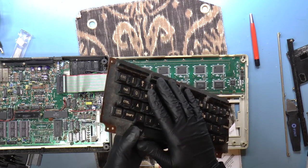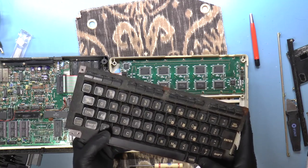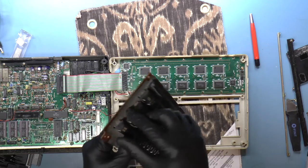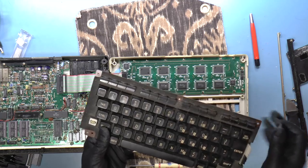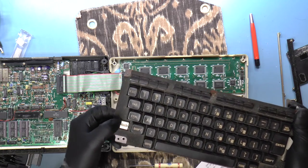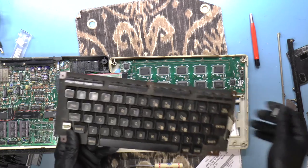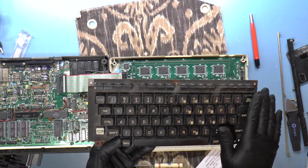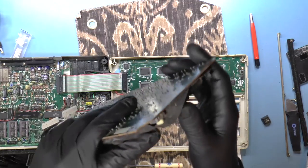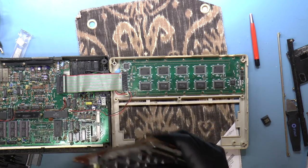All right, so we've got what appears to be fabric on top of, below the keycaps. I guess I could just pull the keycaps off. Is that possible? Yeah, they're still stuck. Let me see if I can pull one of these keycaps off. Maybe the caps lock button. Okay, so the keycaps just come right off, and then the felt comes off of that. So it seems as though the problem with these keys is actually inside the key. So what I may end up doing is what I've done before, basically take all the keycaps off and unsolder all of these keys from the printed circuit board, right? Then you can actually get inside each key and clean it. And that seems to work really well for these keys. All right, so that's something that I'm going to have to do.